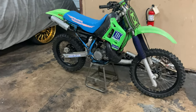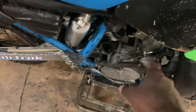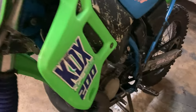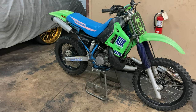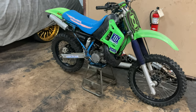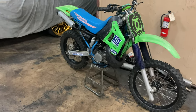Alright, I got everything back together — cleaned it up for him. A couple things to note: his kickstart is loose, so he'll need another kickstart. I adjusted his chain. Another thing I noticed is his transmission is worn out — when you start the bike and rev it in neutral, sometimes the bike will jump into gear, which is a sign the transmission is worn out.